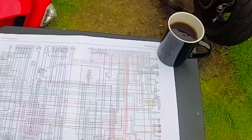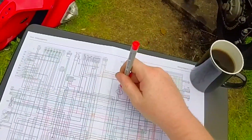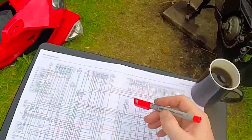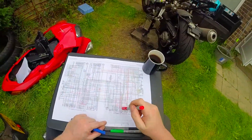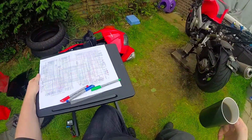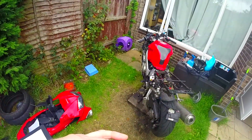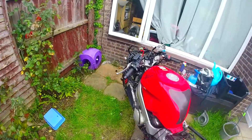So that's it. Basically, those are my components. I now know that that wire, the only place it's going to go, is to this and to the stop-start switch. So it's a case of finding where these components are on the bike. I know where this component is because that's the regulator rectifier. And the engine stop-start sensor, which will be at the front of the bike. Here's what I found earlier — I'll do that in blue, Blue Peter fashion, as I take a sip of coffee.